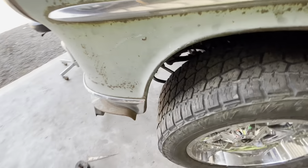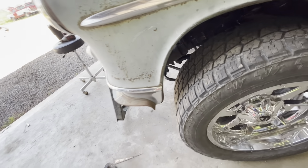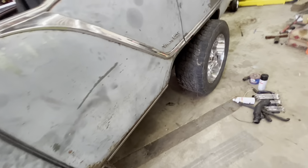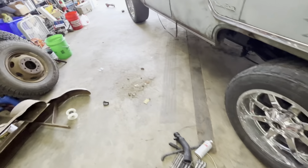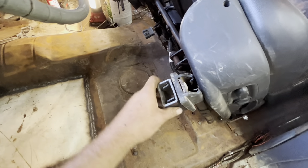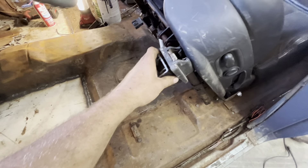I'm not sure if I should leave this sticker on here and make people guess, or have no sticker, or put a different sticker on it. I cut the inner fenders out some more to kind of match the frame height — now the tires don't rub on the front. We've got probably three inches of clearance there, and when it turns we've got probably an inch to inch and a half. So I'm pretty happy with that. For now I'm gonna get back to welding — I've got a bunch of fab to do, bumpers, cutting this out, and welding. I've got a busy day.